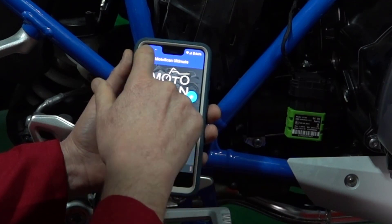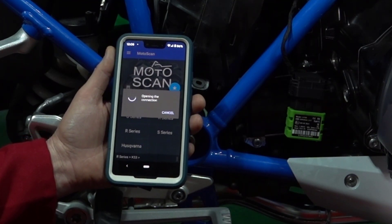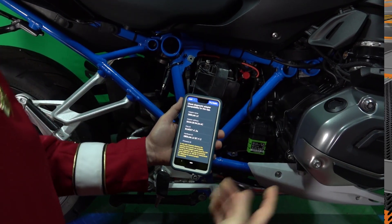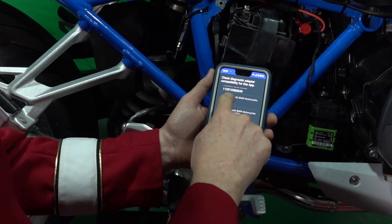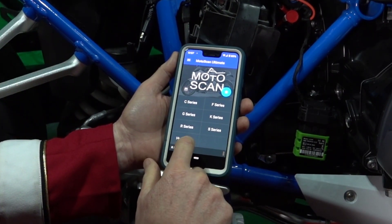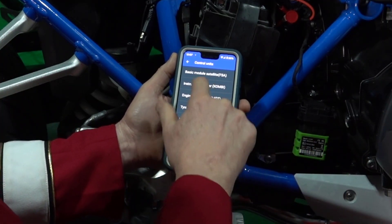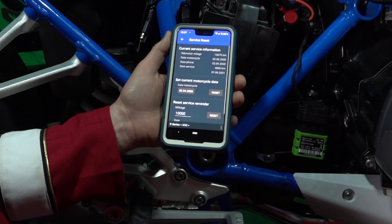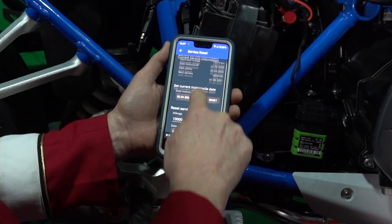Then I'm going to go to Adapter Check — it's opening the connection. This may spin for a little bit. Once it spins, it tells me my adapter address and everything is good to go, compatible. Here it's compatible with my K bike. So now I'm going to go to my K53, which is my bike. And this is where things get interesting — if I go to my instrument cluster, I can then go down to my service reset. Here I can reset either by date or mileage and date, and I can reset my service.